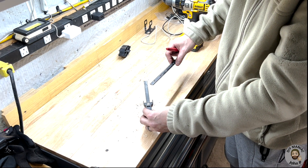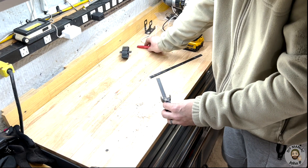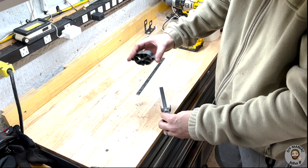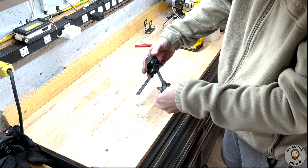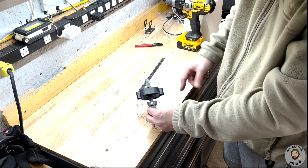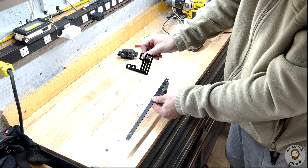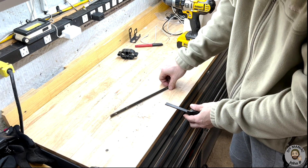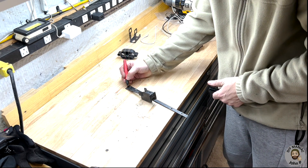With our linkage rod now cut to length, you can see we removed the 11 and a quarter inches and this is what we're left with. In terms of that spacer, we really don't need to use it anymore. The main reason it was there was due to the length of this linkage - it was to take up any slack or rattles that could happen due to the length. Because it's so short now, there's not much reason to reuse it. We need to mark now the holes to rivet the sliding latch pin bracket - put your bar down, bring it end to end, and using your marker mark exactly where the holes are, then drill.